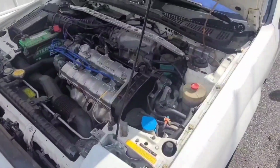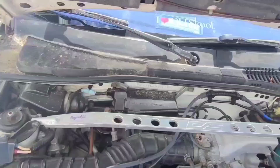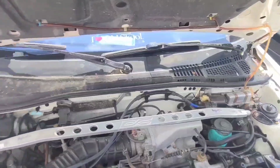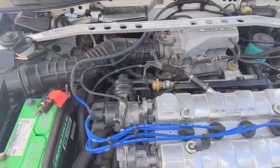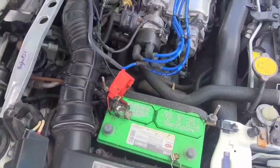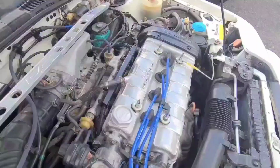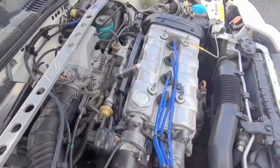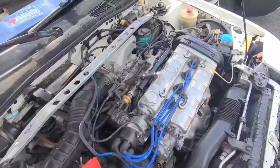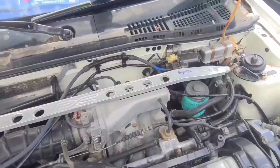I'm just looking over the engine, making sure the mice didn't get in here and start chewing on things, because they do. It's outside all the time. I don't have a garage. But it doesn't look too bad, except for a little dust and some leaves from wherever they come from, because I have no trees. I usually leave it spotless, but it needs a cleaning. We'll put a new air filter in her and stuff. I'll check the distributor cap for condensation and corrosion. And the plugs should be good. I barely had it running when I put them in, because I put the polished valve cover on. It's a little oxidized, but it'll clean up with some soap and water and a little detergent in it. The rest of it should be good.